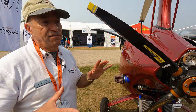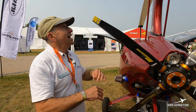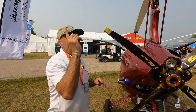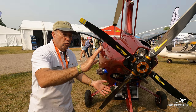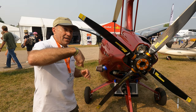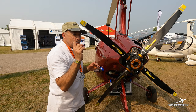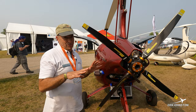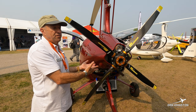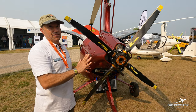Old versions of gyroplanes — the ones that came out about 50 years ago — didn't have a pre-rotator. That meant when you wanted to take off, either you or a friend had to put your hands on the rotor and spin it to start it turning. As the rotor spins, it's angled to the wind, and as the gyroplane pushes forward with the engine, wind rushes up underneath — the more wind, the faster the rotor spins, generating more lift. So you had to slowly go down the runway to build speed until there was sufficient lift to take off. Once a gyroplane is in the air, it flies similarly to a fixed-wing airplane. If you have a fixed-wing license, you could take the stick and rudder and control left, right, up, and down — you might not be precise, but you could fly it. Takeoff and landing, however, are very different.